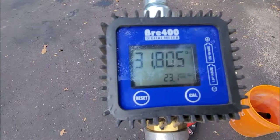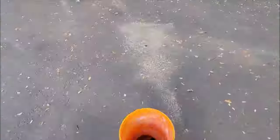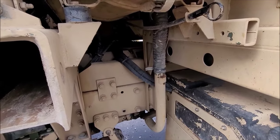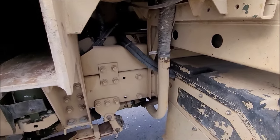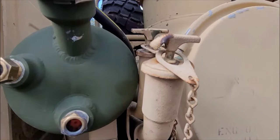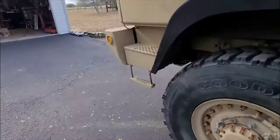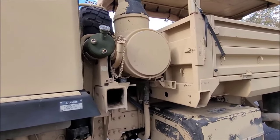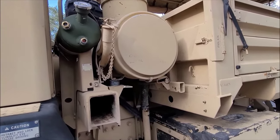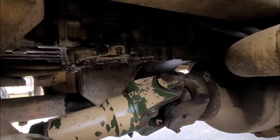Just finished filling it up. Did 31.8 quarts like the TM says at an oil change. The dipstick was showing it a little bit high. I went out and drove it and it's definitely shifting a lot smoother — the very first shift it kind of sounded like it sucked a bunch of the fluid where it needed to go. The truck should be idling when you're filling it, otherwise the fluid's going to have a hard time going in. I refilled with Rotella 15-weight-40 engine oil. Some people switch it over to ATF — I keep a ton of 15-weight-40 around and I'm in a warm environment so I don't need to worry about it. Hoping it's going to cure that oil leak, but I've got to take it for a good drive.